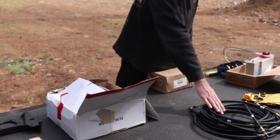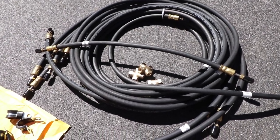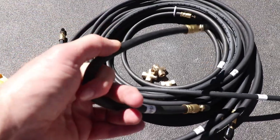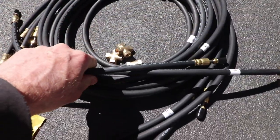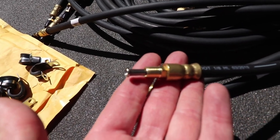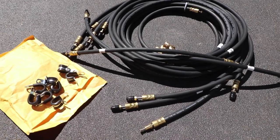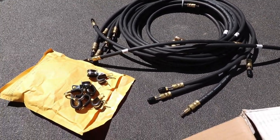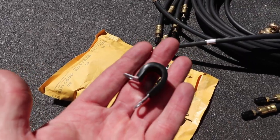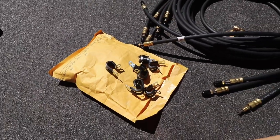Next up we have brake lines. I bought this rubber brake line kit, which is designed for a tri-axle trailer, but you can get them for dual axles and single axles as well. I chose to go with flexible rubber just because it's easier to manage than rigid metal tubing, especially for a DIY project done on the road. I'm going to show you how you can do this whole thing with minimal tools — you could do it anywhere in any sort of campground as long as you have enough time. The brake line kit comes with little clips for attaching the brake line to the underside of your trailer.